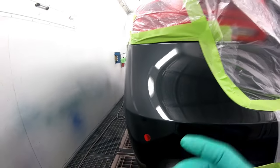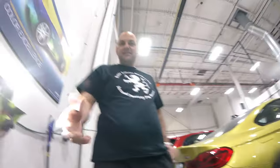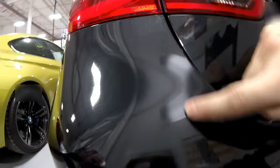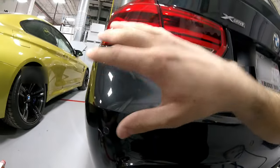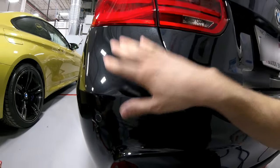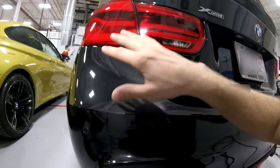I'm going to bake this for 20 minutes at 120 degrees. So we got the blow-in here ready for polish. As you can tell in the booth, I have my satellite there, and Sahari is my good assistant — he's the one that makes all my jobs look presentable. He's doing very good detailing. There's a little bit of overspray there. What I like to do with blow-ins is do as little as possible. If you don't have to sand them, don't sand them. The preparation is very, very, very important — that way you don't have to do so much after.